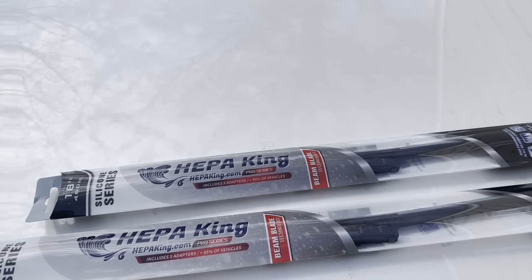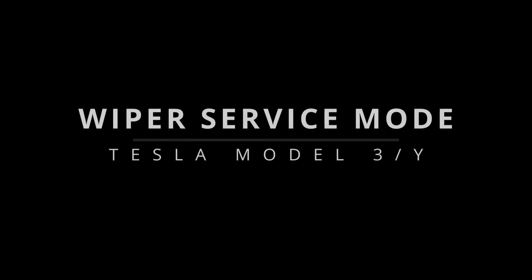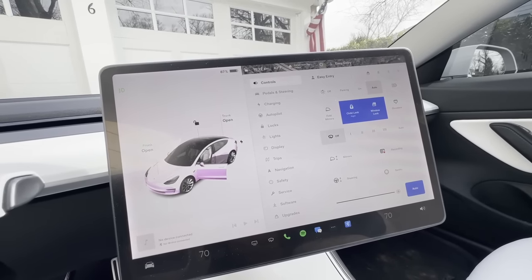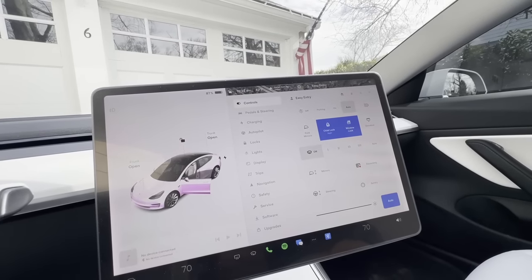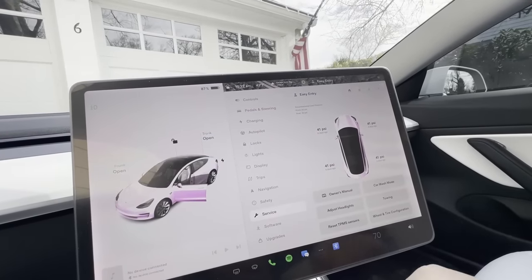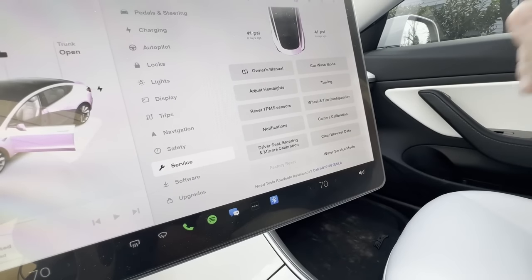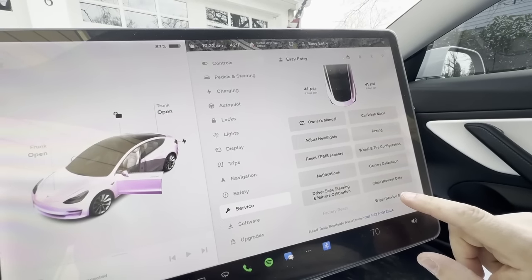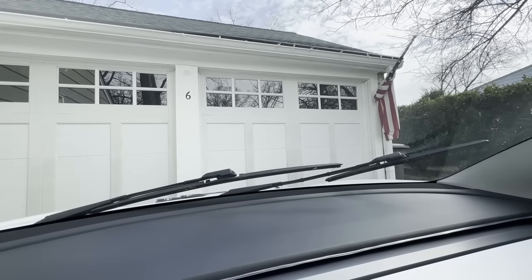Let's go into the car and start by checking out how we can go about getting the wipers into service mode. First thing we have to do is go into the cabin of the car and put the wipers into service mode. You're going to go into your main interface by hitting the car button, go into Service, then scroll up and you will see a button that says Wiper Service Mode. When you click that, your wipers will come about 6 inches up from the resting position — you can see there — and that is how you proceed with swapping out the blades.